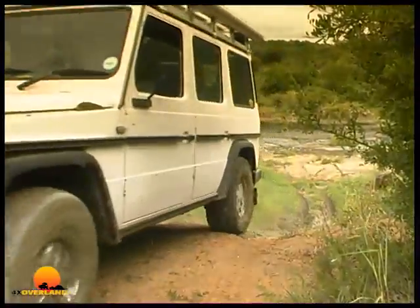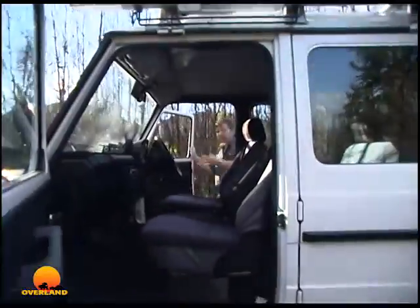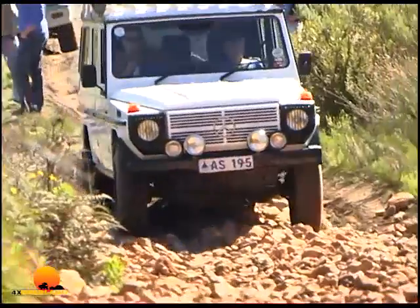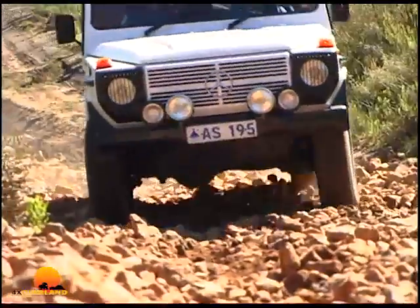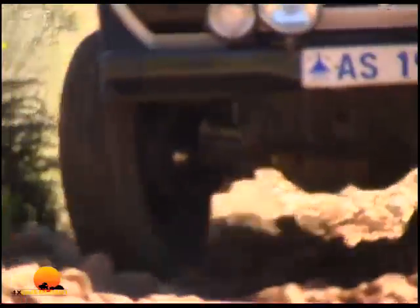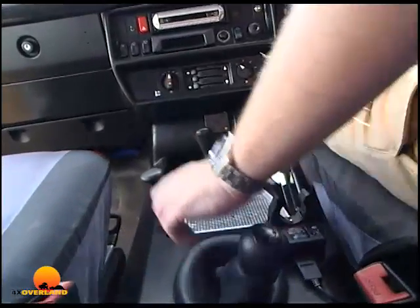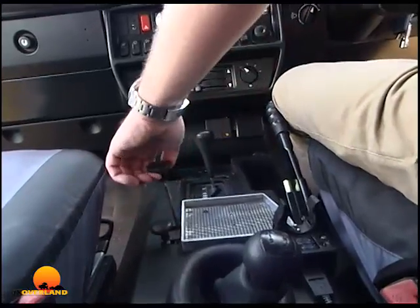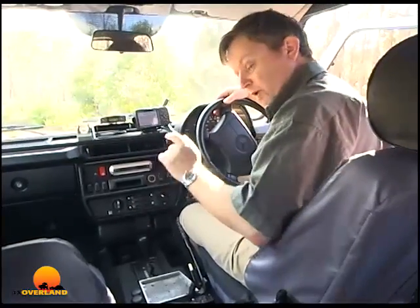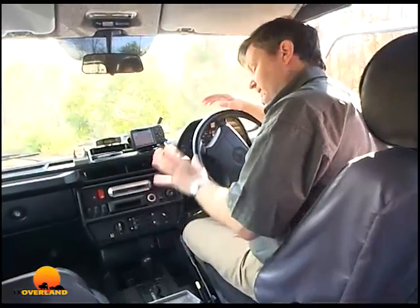When the G-Class was released it was compared with the Range Rover, because it had very similar suspension. But it's a completely different animal — the Range Rover being top in the fashion stakes, while the Geländewagen was always meant to be similar to a Defender or the rugged Land Cruiser FJ series. It's a rugged, basic workhorse. Rear differential lock — hydraulic. It's a relic of the military designs that Steyr-Puch were involved in. Front diff lock also hydraulic. The automatic gearbox is very well tuned to off-road use; the gear change is very rapid, which makes it a little rough on the road. They haven't changed this since 1979 — it is exactly the same.